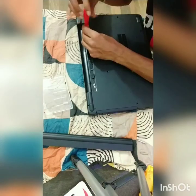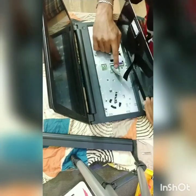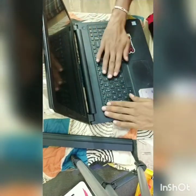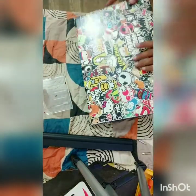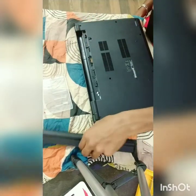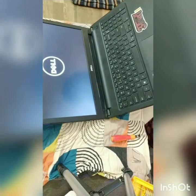Fix the keyboard back in. Make sure all the screws are connected. Plug in the keyboard cable, slide the keyboard back into place, and make sure it sits flat. Then plug in the battery. The battery is fixed. Now check if the laptop switches on — you can see the power light come on, and there you go, it's on.